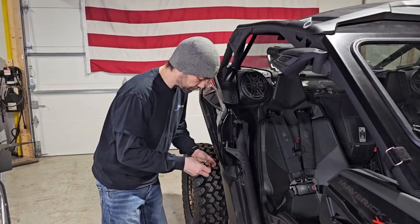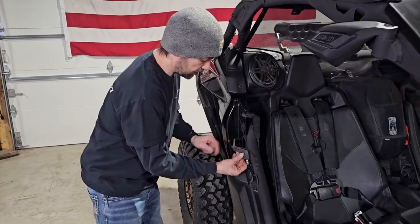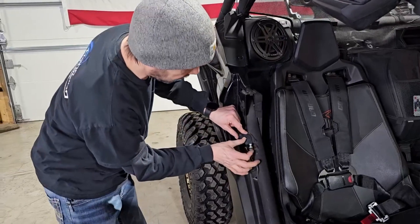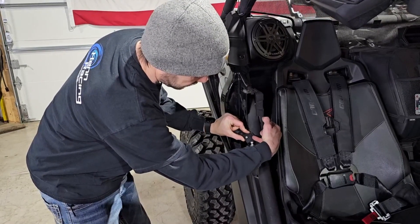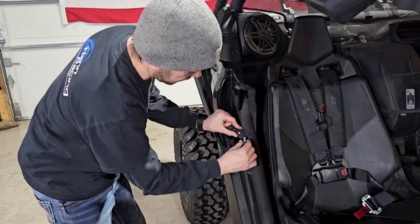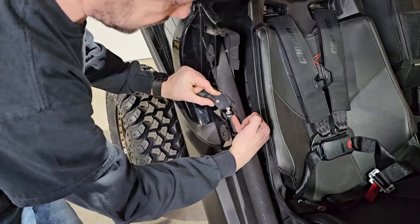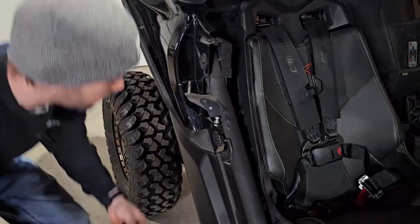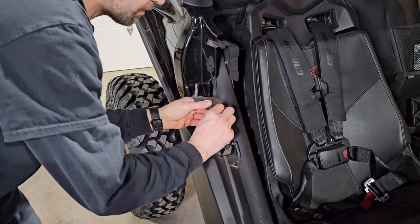When you do this, you're going to put it in your old mounting hole where you drilled out the check strap — just line that hole up and put it there. It's key to get this surface right here parallel with these rivets. Don't have your tab swinging out; keep it in line following the rivets. Then you're going to tighten down the one bolt, one screw here.